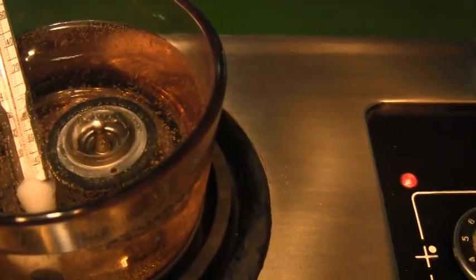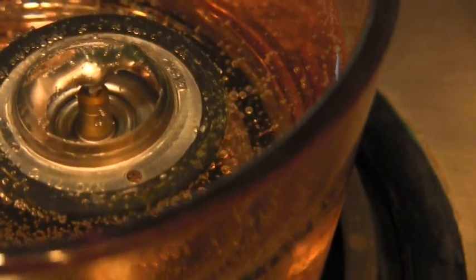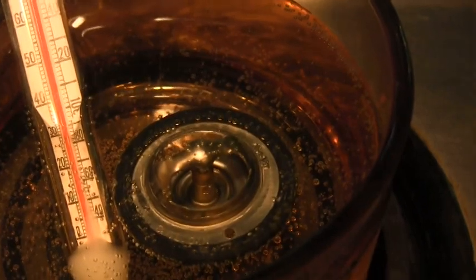It's 186°F and it's supposed to be fully open at eight millimeters, and I don't think that measures eight millimeters — I don't know if you can see down there or not. You can see somewhat through the glass — there's my finger down through here. I think I'm going to get a new thermostat anyway. We're up to 190°F now and it is open. I'm going to pull it out and see if I can get a measurement on it, then stick it back in and let it cool down to see what happens.